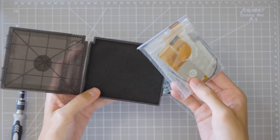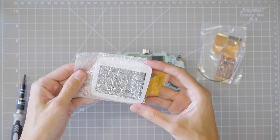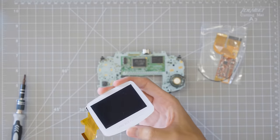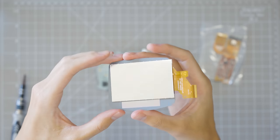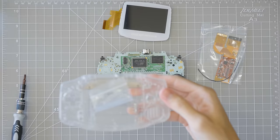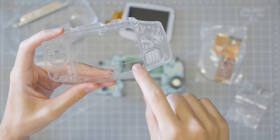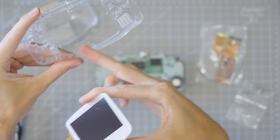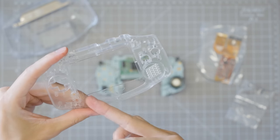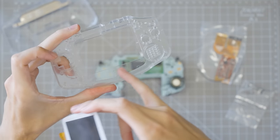So here is the new display. It came with a ribbon cable for both 32 and 40 pin models, and of course the beautiful display itself. The display I went with is the Funnyplaying laminated 3.0 IPS. The screen lens is already attached to the screen — hence the name laminated, it's all together. These Funnyplaying IPS mods do require a custom shell. I decided to go with the fully transparent, but — does this not fit? Is this not an IPS-ready shell? This inner plastic frame here is the problem.